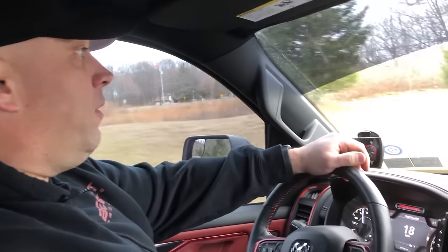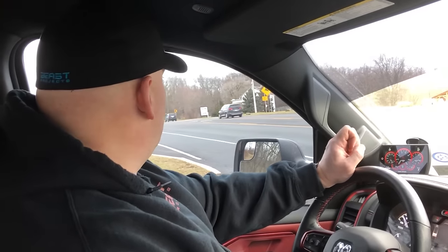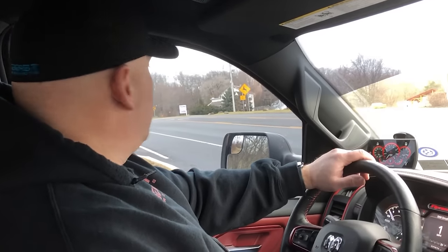Now, when it completed, we did have a check engine light, which is no big deal. There's a thing in there for engine diagnostic, clicked on that. It was two trouble codes for communication with the TCM. We cleared those codes, started the truck back up, running fine, no issues with the transmission. I took it for a little test drive.